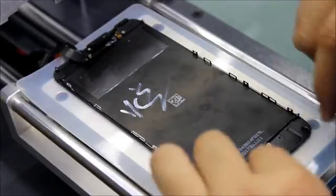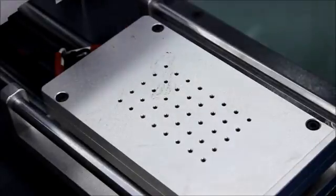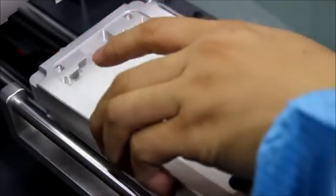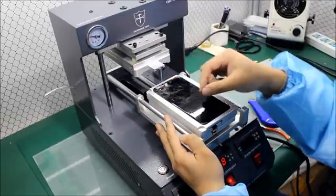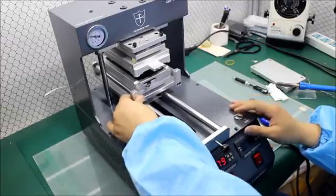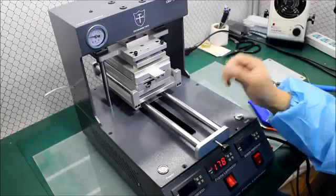Now this frame — these four corners already have the frame melted. Now we use this machine to melt all the frame. What we need is the iPhone 6 Plus mold. We already put the broken glass on this mold. Now let us heat the frame; the glue will melt. Once the glue melts, it is very easy to remove the frame. This machine is not only for lamination of a new frame on the glass — it can also be used to remove the old frame from the broken glass.